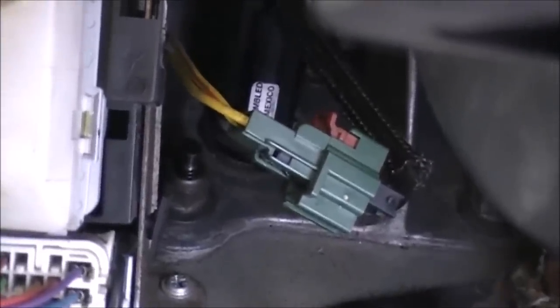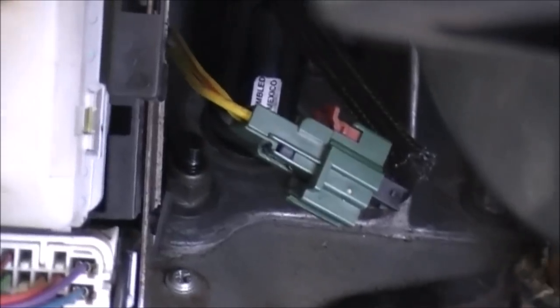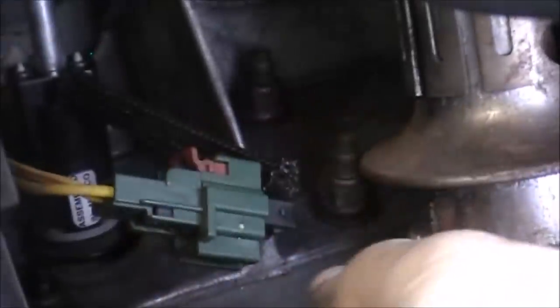All you got to do — you see that red clip on top? It's kind of a tight little place to be in. This little red clip right here, all you got to do is force that red clip forward with like a punch or something like that. And then that will allow you to disconnect this plug. It's like a Framatome connector that you find on big trucks. You force this red part right here forward and it will allow you to disconnect this switch.